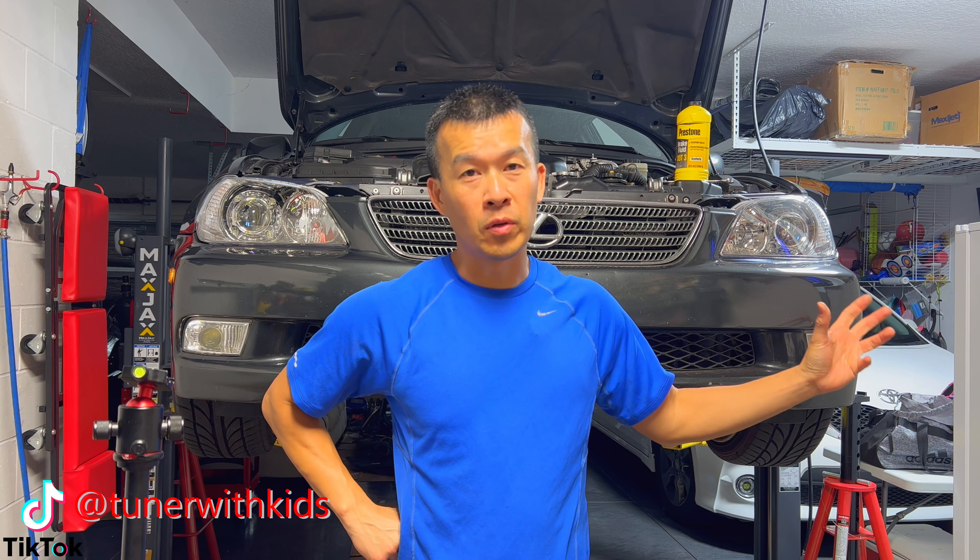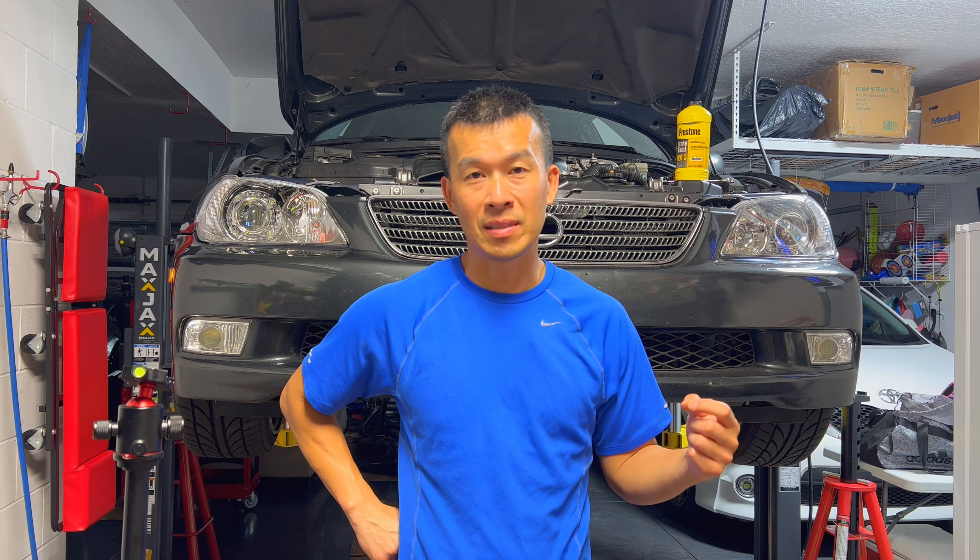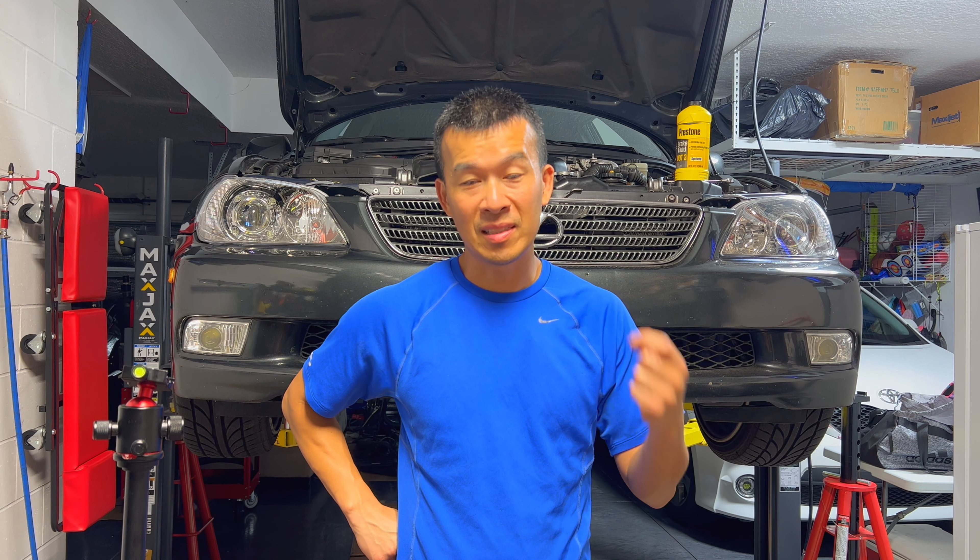Thanks for joining me all the way to the end of this quick video on doing that slave cylinder rebuild, getting it in, doing all the wiring, tubing, and bleeding — but then we had a little bit of failure. After research, it looks like Chase Bays and others actually use a banjo fitting into the slave instead of a direct fitting. That might be my issue causing the leak, because it wasn't designed for a direct fitting like that. I'm going to order a banjo to 3AN adapter and see if that fixes it.